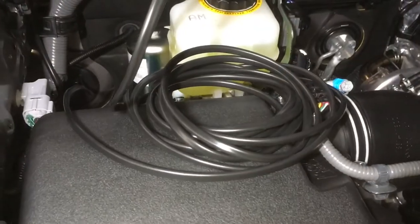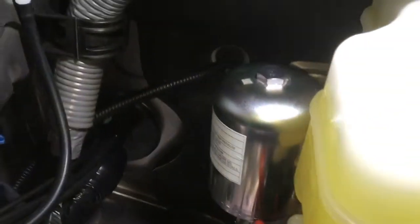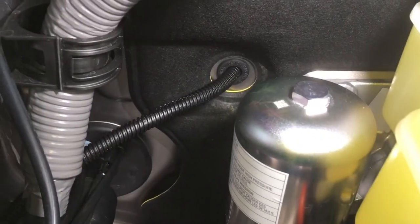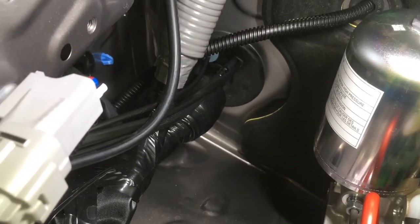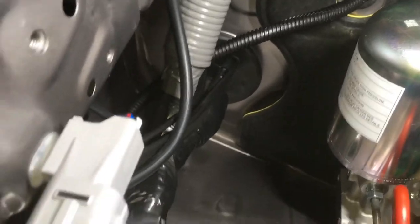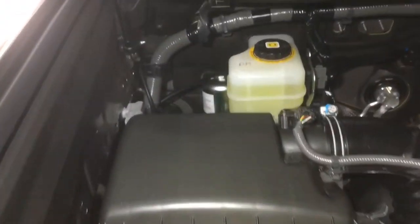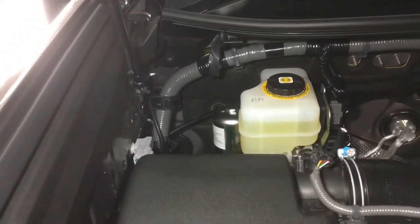We're just going to get this wire in position, being able to pull it either way, so we'll sit this bunch here down the side of the battery. I've literally spent a few minutes and got it out of the way. Look how neat this is - it looks like factory wiring. The one that comes out with the water wire is not going to rub on anything. It's with other wiring looms and a vacuum washer pipe, into that plastic clip down there, and another plastic clip. I've just got it all wound up there waiting. That'll eventually have another fuse and get connected, but for now that's it going through the firewall until we get the compressor in place.